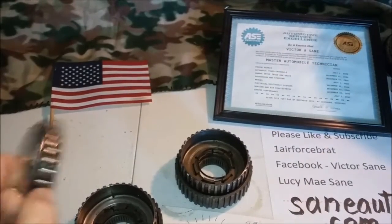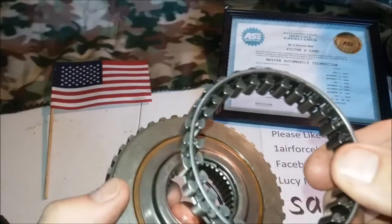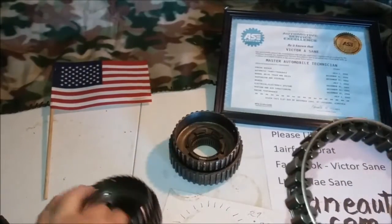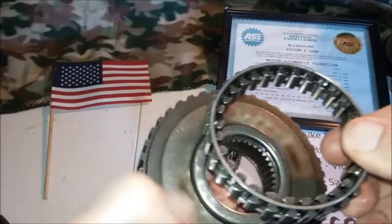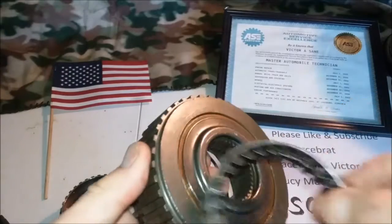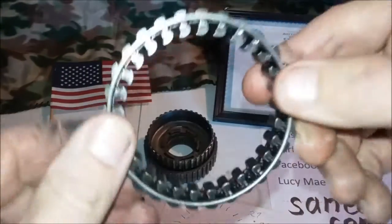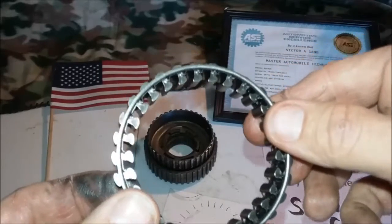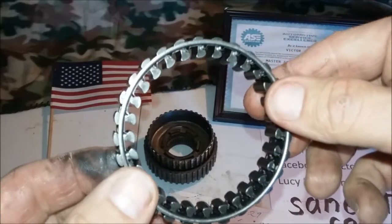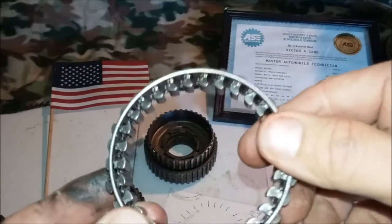What you really want is the 29 element and you can put it in any of these. I would prefer the one with the lube dam and the 29 element, especially if you have to replace the races anyway. But no matter what you do, use the 29 element which is 95 and later — that way you get the best sprag and the best metal.